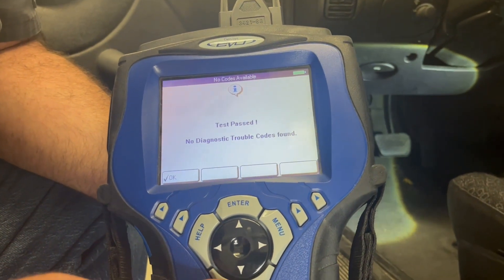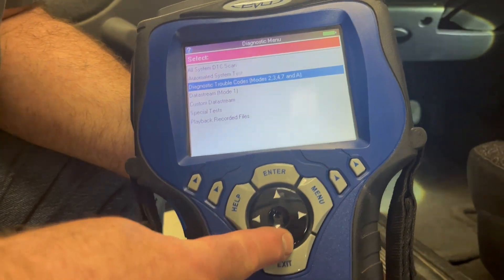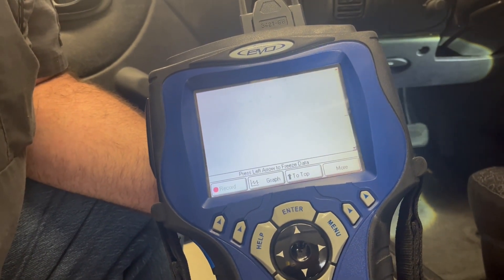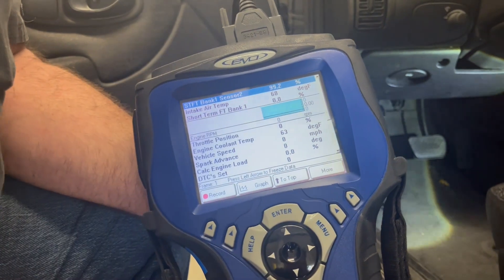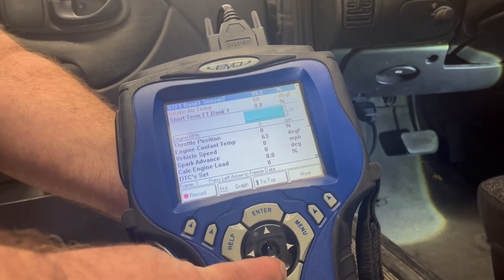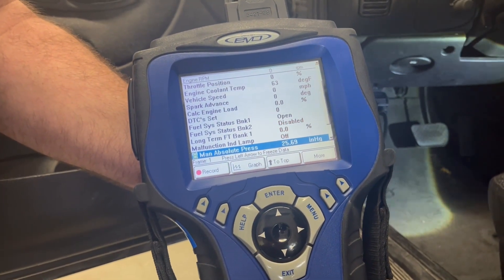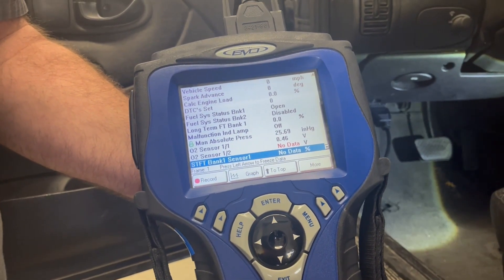After I fix the car and verify the check engine light is off, I can exit back. The data stream is a generic data stream — this is where I finish my lab, going into the different sensors and actuators. We have throttle position — you can see there's no data at first, but after a second it changed and there's now a value and a percentage. I'm going to record all of these sensor readings on my worksheet, going from no data to what it says, being patient with it — key on, engine off.